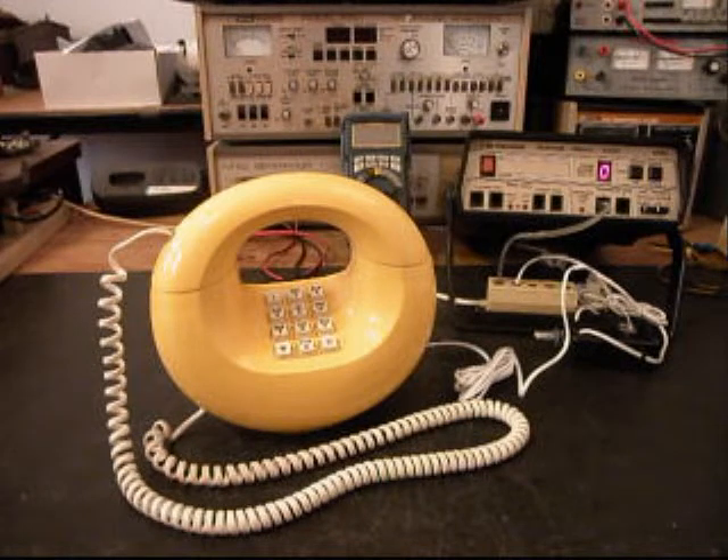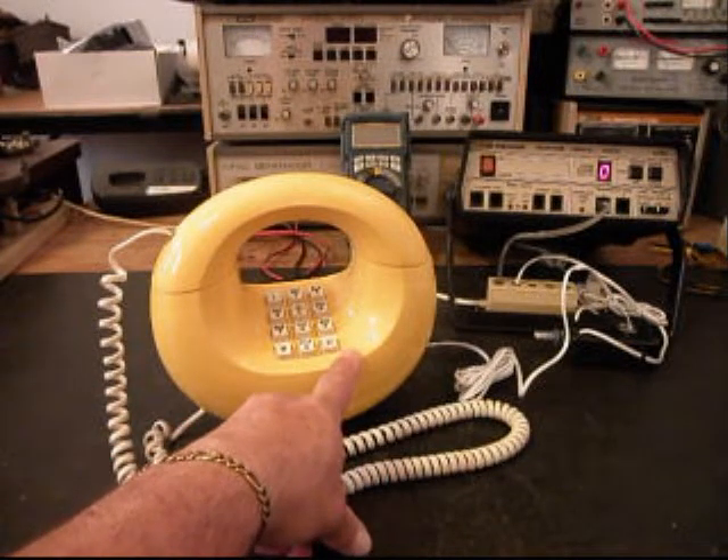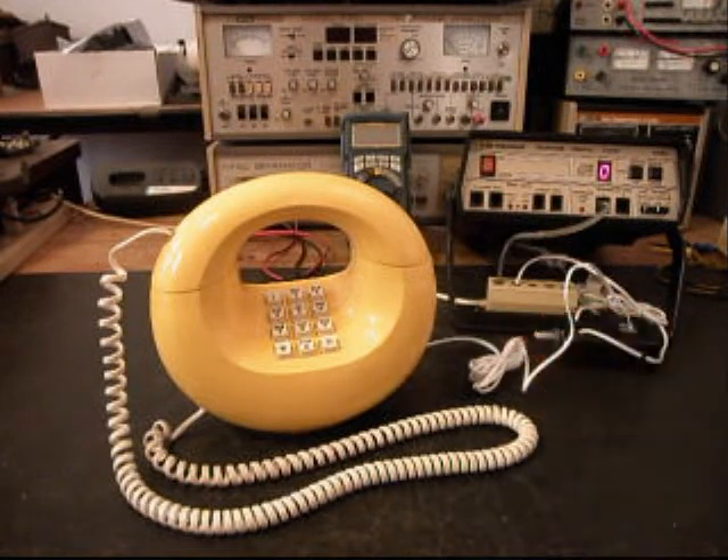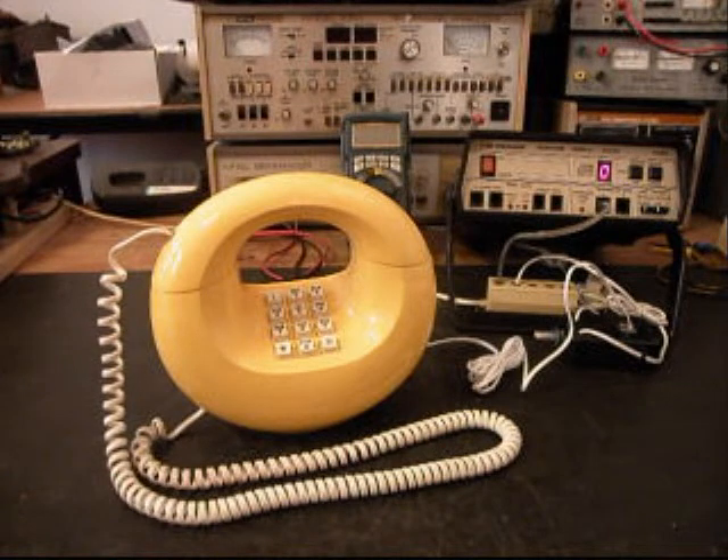Okay, we're back now and we are finished up with the repair of this telephone. We had to replace the network because the network was broken at the transformer, and I didn't feel it would last very long, so I went ahead and changed the network. We also changed the modular port for the line cord, and we have a white line cord plugged into it. The handset cord is just a shop cord — Sam has her cord and she'll put that back on when she gets the telephone back. We went through everything. We didn't touch the bell, so they have a piece of paper stuck in the bell so it will not ring, and that's the way they wanted to keep it.